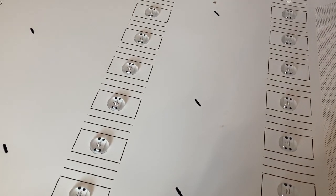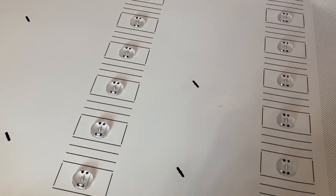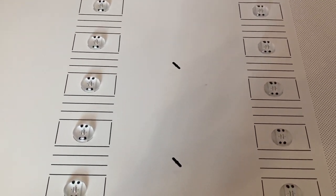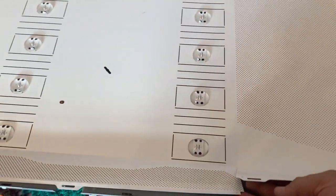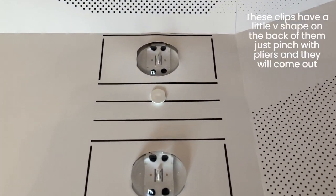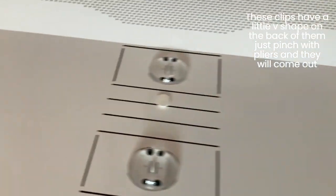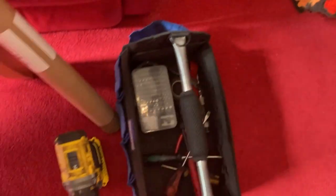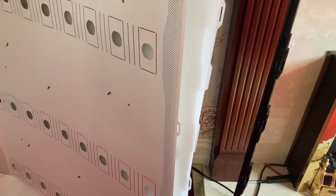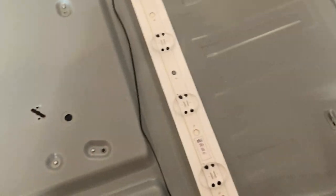Carefully lift off the backing sheet over the LEDs. There are a couple of studs across the TV just holding it down, so we pop those out. That's the back sheet for the LEDs — the LEDs just protrude through the holes.